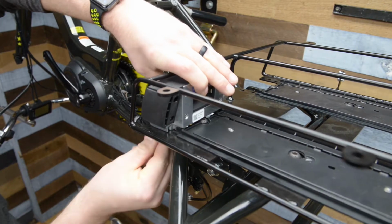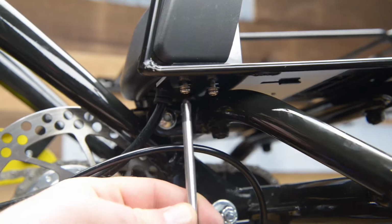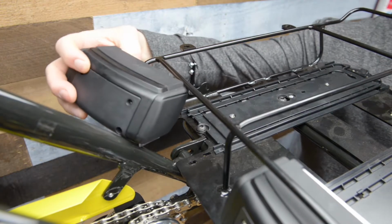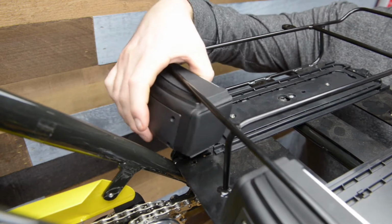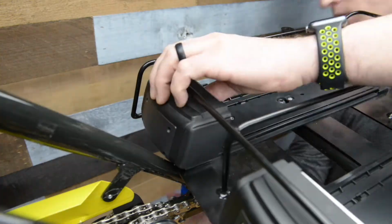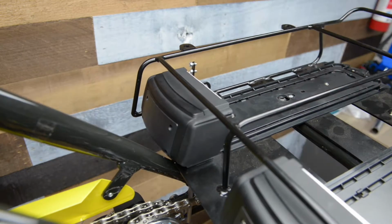Insert the power box with the prongs into position on the left side of the battery holder using the 4 mounting screws. Install the other power box on the right side of the battery holder. The right side battery mount is there so you can carry a spare battery, but will not connect power directly to the trike.